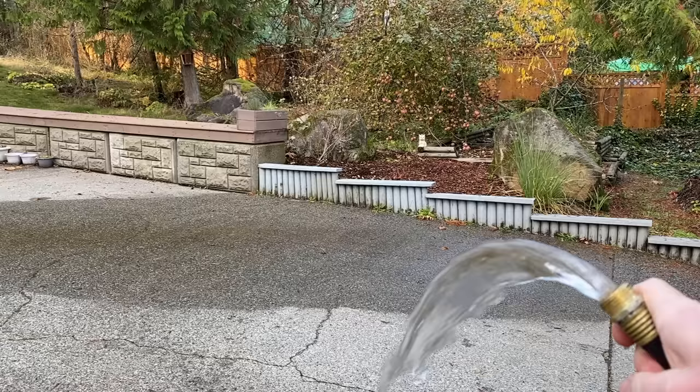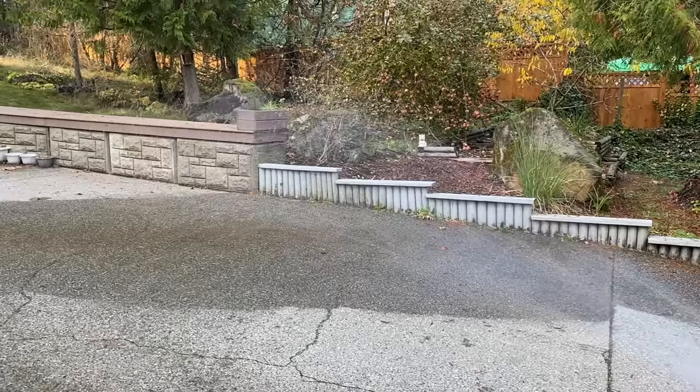Why are they doing that? To increase the air speed coming out. You ever put your thumb over the end of a garden hose to shoot the water further? It's the same concept. Yes, you are going to get more speed of the air coming out if you restrict that hole down a little bit. But you are also restricting the CFM — cubic feet per minute — the volume of air coming out. And you're revving that engine up past its limits. You can blow your engine apart doing that.